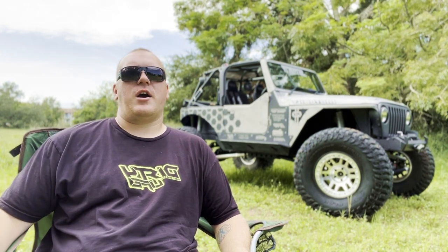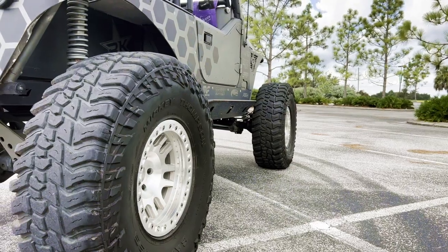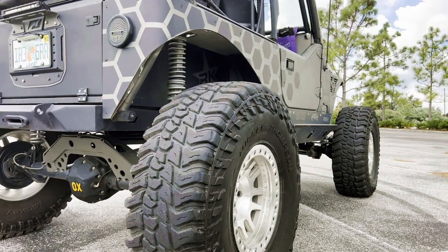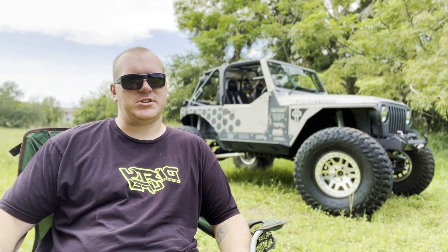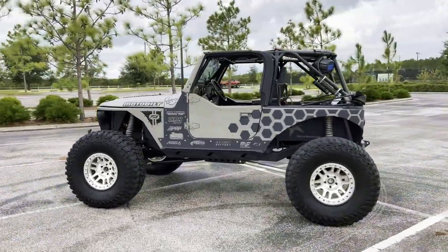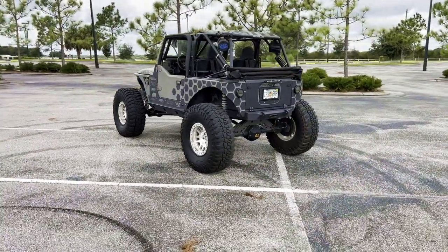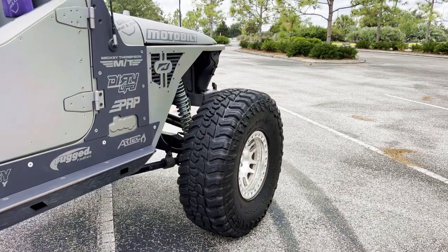The rear I actually ended up stretching a second time. I was at 102 inches and I ended up pushing it back to 108 inches, which is where it's at right now. I want to get the front stretched a little bit more in the future — I'd like to end up around 112 to 113 inches. Every time I stretch this Jeep it's been an improvement. One thing that has remained the entire time that I'm absolutely impressed with is the crawler joints in the control arms. The rock crawler kit I bought initially had super beefy inch-and-a-quarter crawler joints — I've kept those throughout. They don't make any noise, they're super tough, and I just keep them greased and they're good to go.